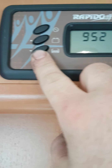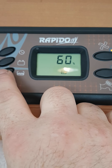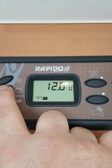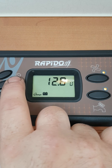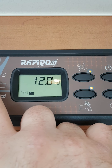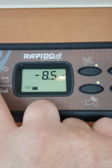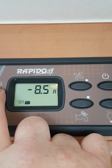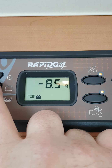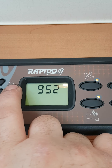This button here tells you your fresh water level — you are 60% full at the moment. This one in the middle shows you your leisure battery, and that's your engine battery. The reason it's 12V at the moment is I am not plugged in; once you plug the van in it will jump up between 13 and 14V. That shows you what current the van is drawing, and that tells you your engine battery voltage. And here you just have your time display.